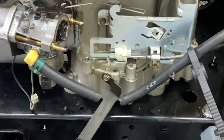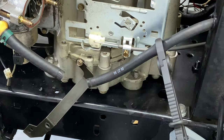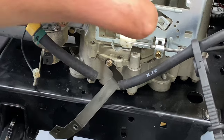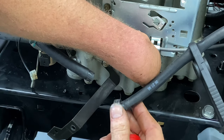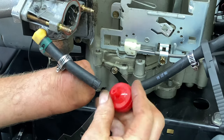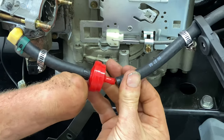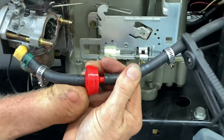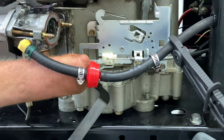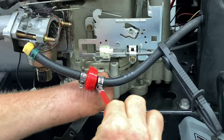I'm going to take off this clamp because I said I was going to use a different clamp for the fuel line. We have a new fuel filter that we're going to put in line. We need two clamps — put one up here and the other down here, then put the fuel filter in. I like to use hose clamps so I can tighten them. Tighten these up — you don't want to go too tight, just snug — make sure they don't leak.